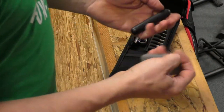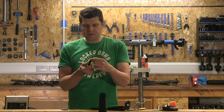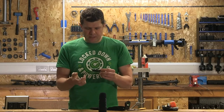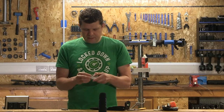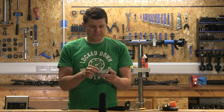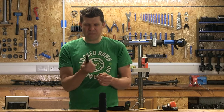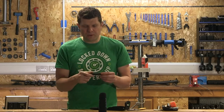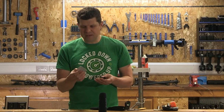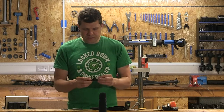A tubeless repair kit — all my mountain bikes are tubeless. This one is primed and ready to go: you pull it out and there's a little black slug already ready. If you get a puncture and you start seeing tubeless sealant coming out, quickly grab one of these, slam it in — job done. There's also a little case full of extra plugs. You can get a lot more success with these on a mountain bike than on the road; on a road bike they tend to pull out on slick tyres, but with all the knobs on a mountain bike they just seem to hold for months.